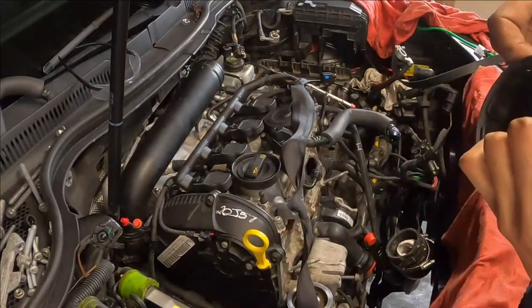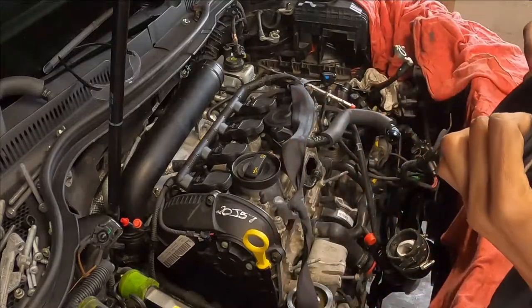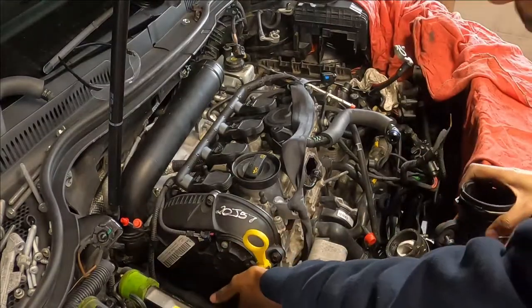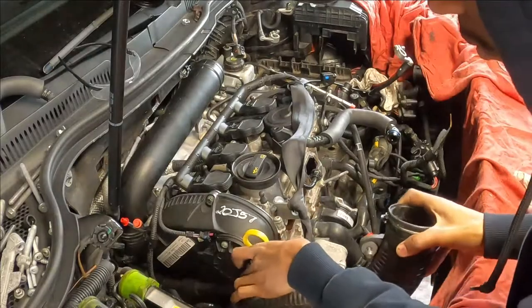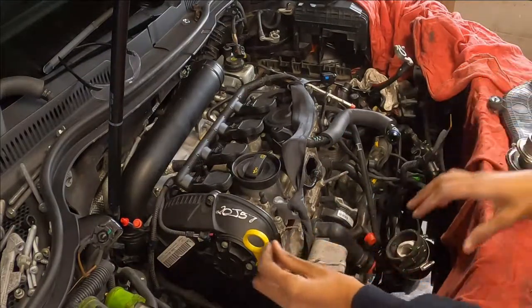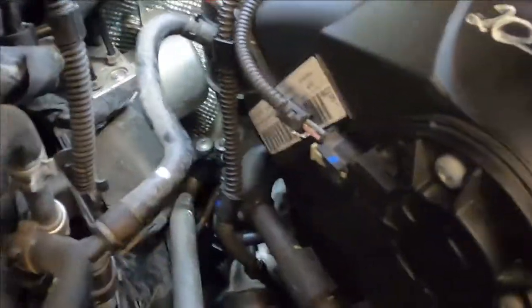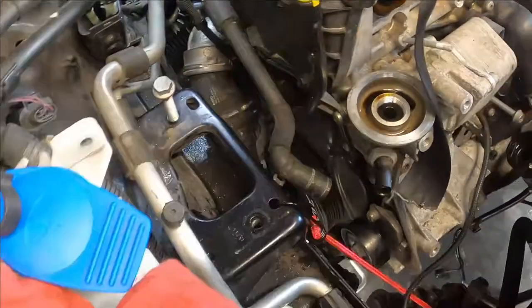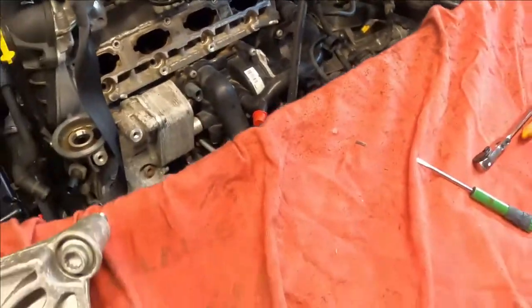Put the clip back. Don't forget the O-ring for the intercooler line. The exhaust is in with the bolts tied. For the intercooler line - the turbo's in and the wires and the brackets are in. You can see some of them over here - for the spark plugs and coils. Now I'm putting the bracket for the engine mount, then I'll remove the jack and torque the bolts for the engine and transmission.